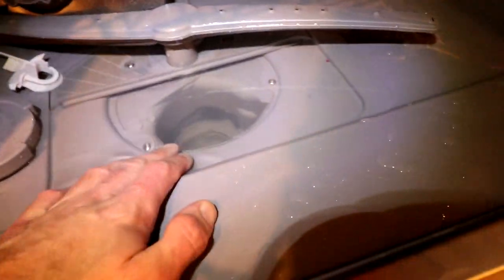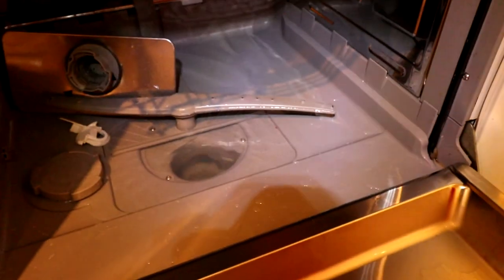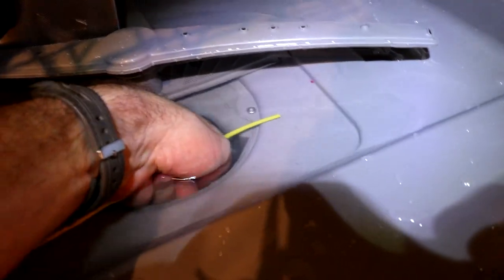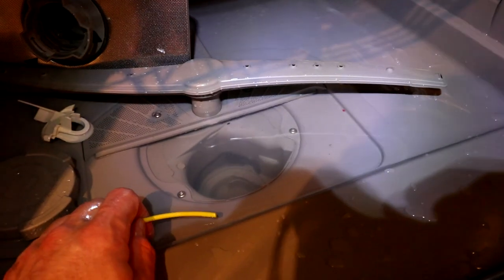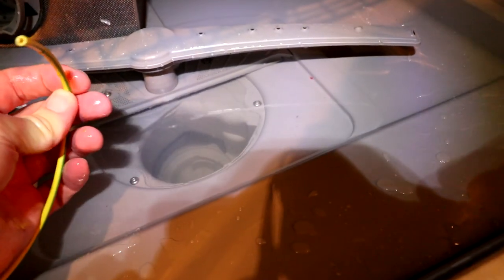I sponged it out and tried it again, but as you can see I haven't got very far because it's still blocked with water. The first lot was dirty rinse water, so I've emptied it with a sponge. I checked the impeller — it's turning okay. Obviously make sure you do this with the mains unplugged. It doesn't seem to be a knackered impeller. What I've got here is some rubber tubing — actually earth shroud for earth wire — anything soft will do.